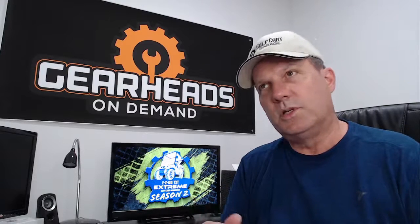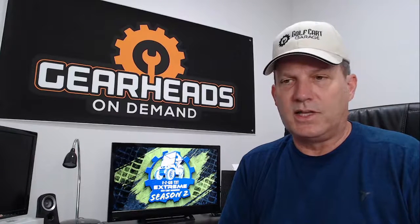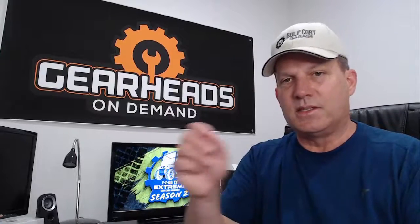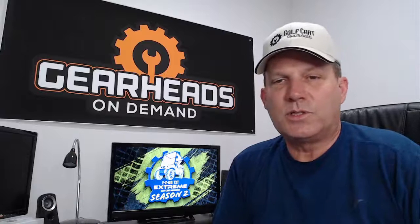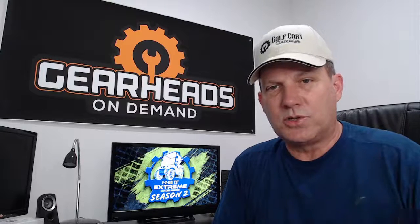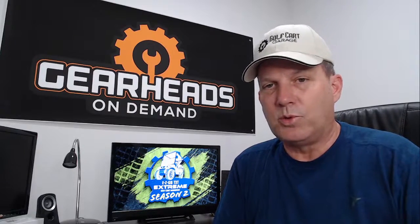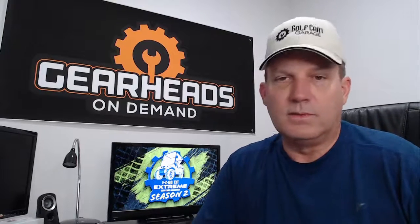There's another company, Allied, that has a couple of different ways. You can buy single batteries and hook them up normally, or you could buy one single battery that has a positive and a negative connection and hook it up that way. So you just need to decide which lithium battery you're going to go with, and then ask those two main questions about the charger and the fact that you have an onboard computer. Are you going to need to bypass your onboard computer or not? They'll know the answer to that question because that's what they do.